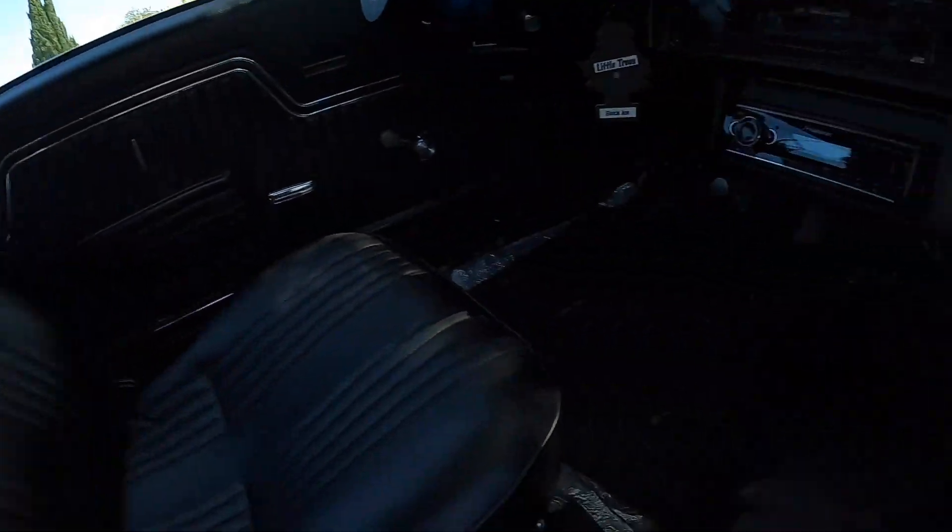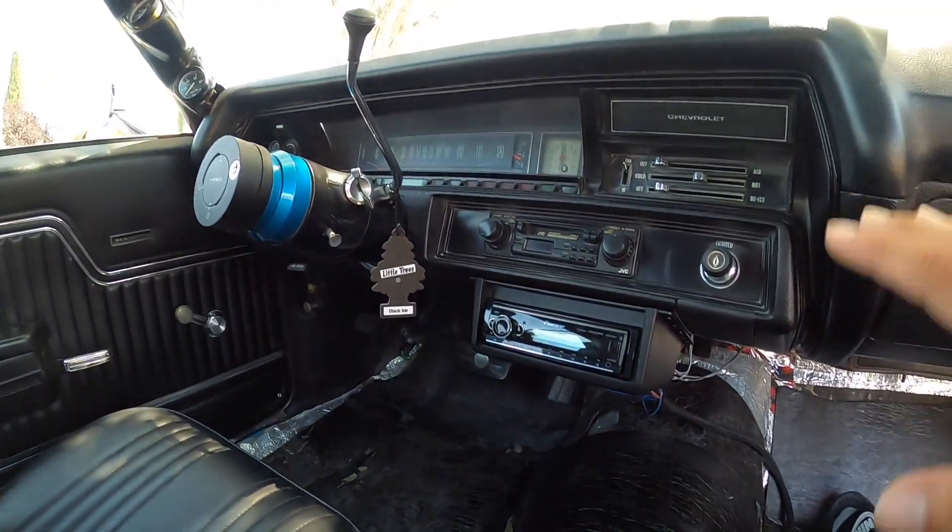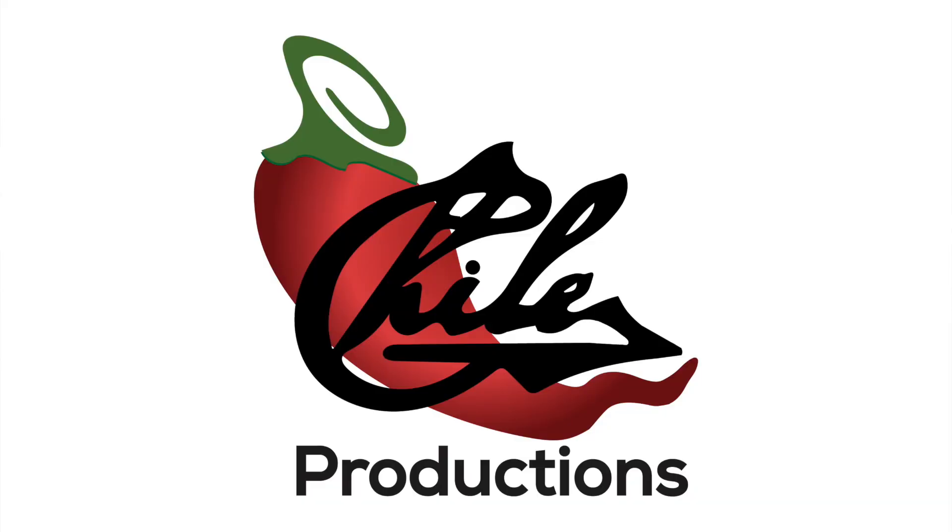With the ignition fuse box done, I can go to the drive-ins, put on the stereo, and not worry about the brake booster constantly cycling. It took me a long time to find a video explaining how to install an external fuse box; most forum posts weren't visual enough for me. The key is the trigger wire going from the factory fuse box to the relay — that's your flip switch. Definitely recommend doing this if you have a lot of accessories, it doesn't cost much on Amazon, and you get individual fuses for everything. Use a thicker power wire and you're good to go.